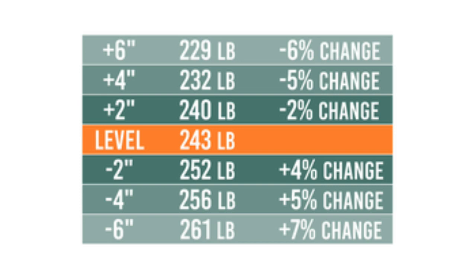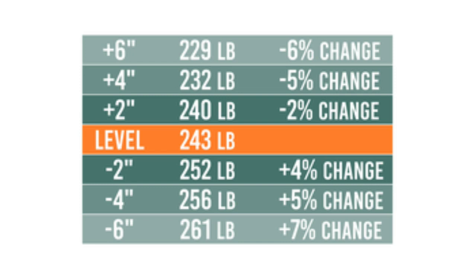Going to get bigger numbers to consider is the water tank built into your camper. My particular one is 11 gallons and weighs about 90 pounds when it's full. It changes my level tongue weight from 243 all the way down to 222 — a reduction of 21 pounds. Something to keep in mind, as some campers have much heavier, bigger tanks. I hope this video was good and thanks for watching.